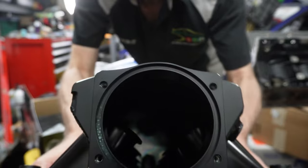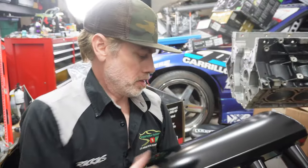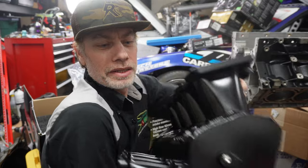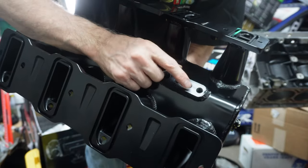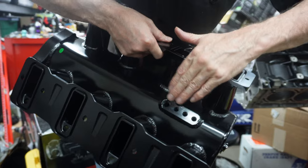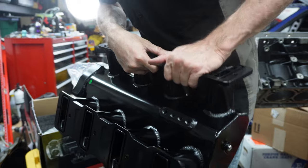That's beautiful — look inside there if you can see that. Yeah, it's got a very nice glossy look to it. I love it, though I actually wish it were chrome, but I'll deal with it. You've got your sensor port for the MAP sensor in the back there, and you've got your vacuum ports right here. We're probably only going to use one or two of these — maybe one for the brake booster — so I might use three of them and just plug one up.